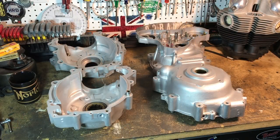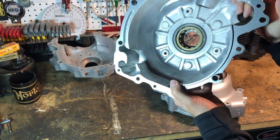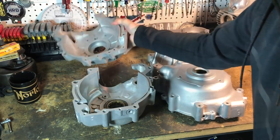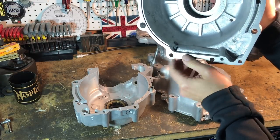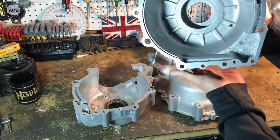For those of you who aren't familiar with the '72 Combat, there are several ways to address the apparent oiling issue, and the oiling can cause all kinds of problems. Some people have claimed that the super blends weren't actually a problem but it was actually an oiling issue. We'll look at these cases and show you a couple different ways that people have approached them. These cases here were modified prior to me getting them, and what you see is the windage tray here has been cut away quite a bit. What that does is expose this as a return now for the oil pump, and in this particular case they've actually sealed up with a set screw the original oil return hole.